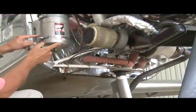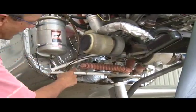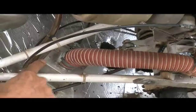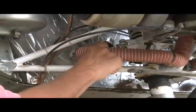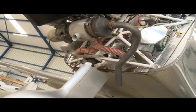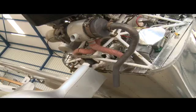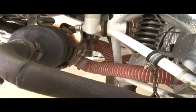This is the oil tank mounting — you can see how that mounts over here, just two clamps onto the bracket. This guy over here is part of the twin cabin heater — it's a little box with a cable that runs up the back over there. This goes onto the muffler over here. The muffler itself gets fitted with a shroud that goes around it, and it's got two outlets — one goes to one cabin heater box and the other goes to the other cabin heater box.